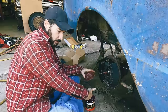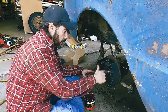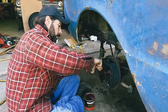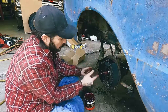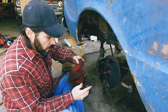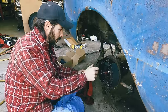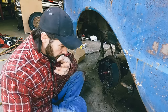Yeah, I'm surprised how good the bearings looked, but from what I can tell, it looks like the other pads and everything, this thing was serviced probably, again, right before it was parked. So saved us some work, even though it sat. Still in good shape. Okay. Gonna have to definitely check the load. It looks like when they put the drums back on, they didn't tighten them. It's like they just hand tightened them and put the cotter pins in. So we'll definitely check the loads on those.